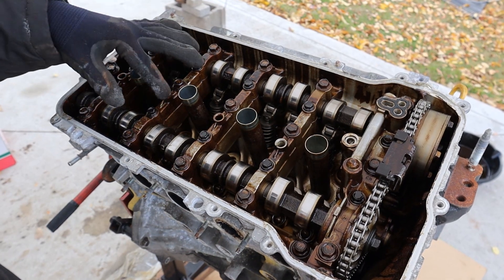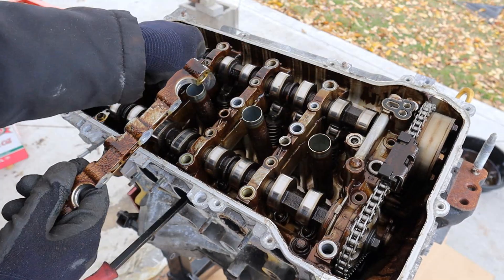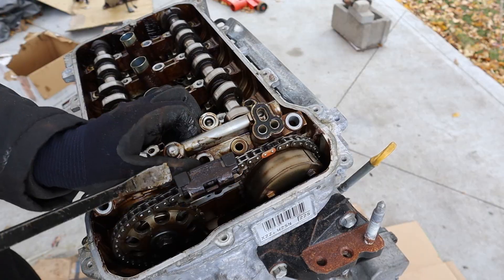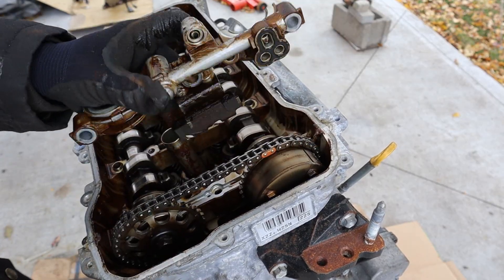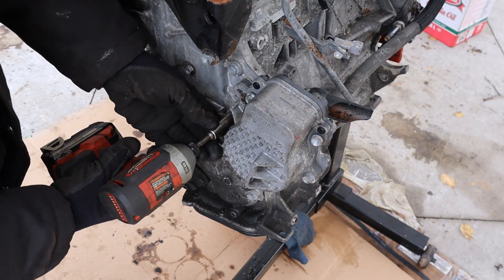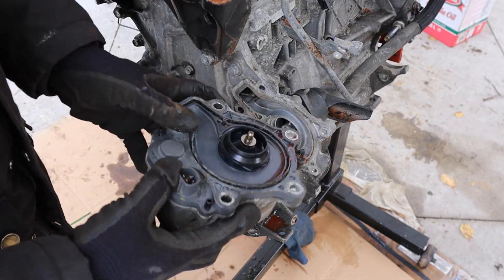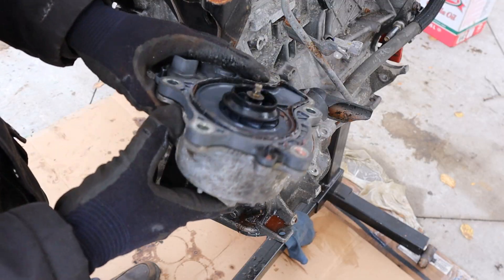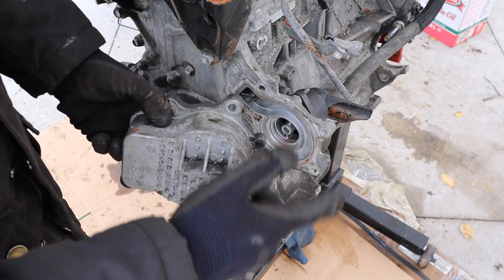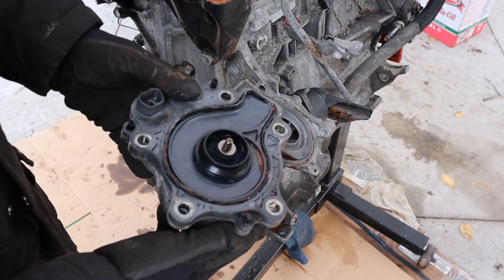Things are so sticky — kind of like when you wake up on a Thursday afternoon. This engine is so simple to work on. Next we're going to move to the front of the engine where we have this electric water pump. Now these water pumps have to be electric because of the start-stop system — when you're in electric mode for this hybrid, this has to turn in order to circulate fluid, not just through the engine block but mostly to cool other hybrid components.